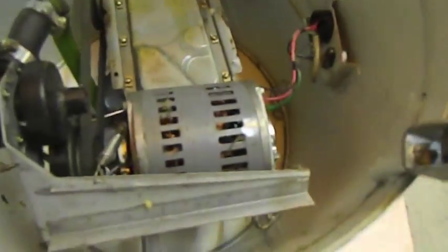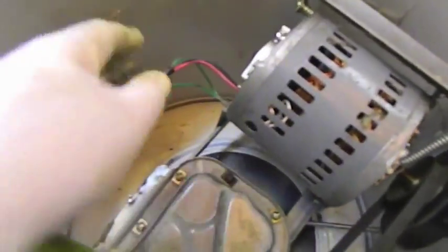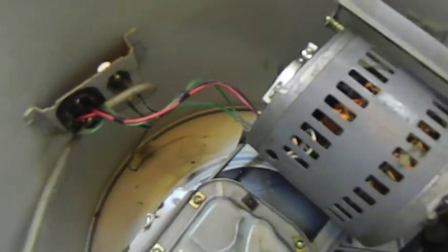And you can see how wonderfully, wonderfully simple these are. That's where it's had its little wee. You can see a bit of water there. So I'm tipping this, there'll be an O-ring or a seal under here, which I reckon's gone. The pump hose also is a bit kinked. But you can see just how simple. Look, there's an active, a neutral, and an earth to the motor. There's no timers. Reset button and a junction box.